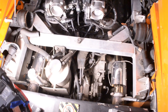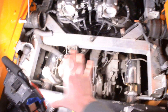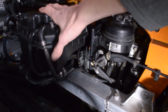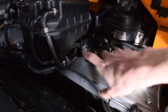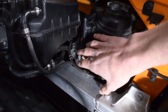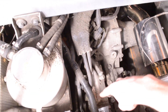So here we are in the engine bay of the Gallardo Superleggera. I have the air box removed — it usually sits in this area. And if you have a base Gallardo, you're going to have another trim piece that covers this whole entire area. In the right of the engine bay, right next to the coolant reservoir, you're going to find your e-gear hydraulic reservoir. And down in here, you're going to find your e-gear hydraulic actuators and the pump. These hydraulic solenoids and this pump provide line pressure to a set of lines that runs underneath this cross member, under here, in through this heat shielding, and then onto your transmission.